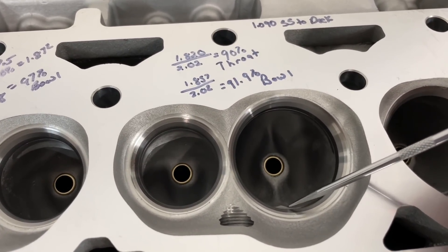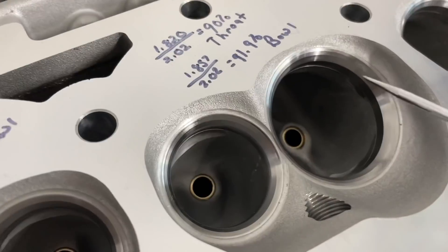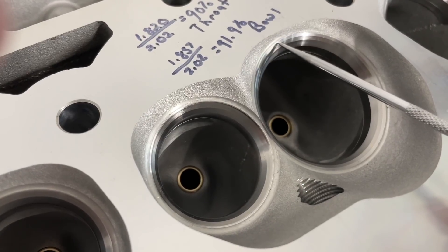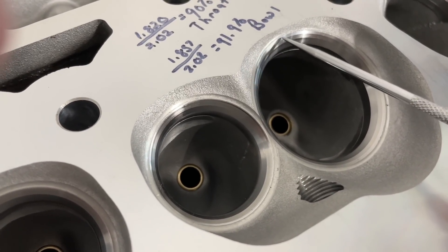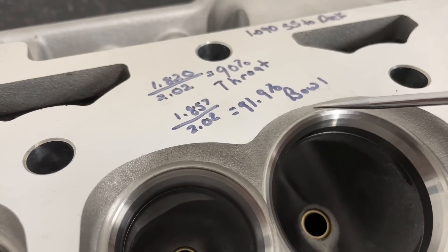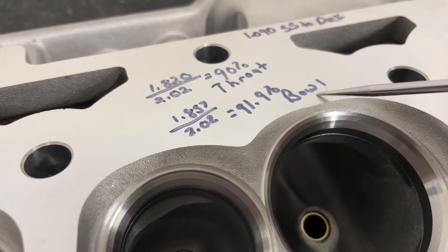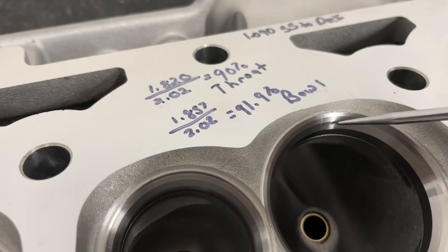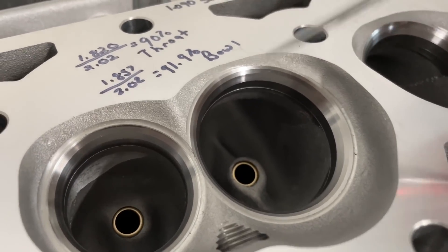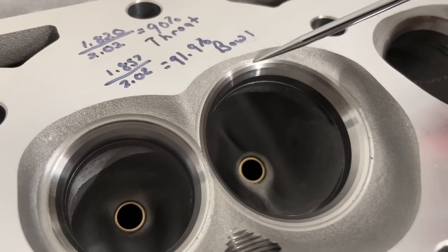So not a whole lot. Exhaust looks like one and then a radius, which is normal for exhaust, and there's probably a small top cut - so maybe: top cut, seat, radius. That's normal. However, a three-angle valve job is not going to flow really great. If you were just to change the valve job you'd probably pick up some flow. All my valve jobs when I cut them will be five angles, and after porting there might only be three because I blend them together - which I'll explain in the porting video. Five is better and it helps with flow. There's a lot of aluminum on this side, and when I surface the head you try not to hit the seat because the cutter will hit aluminum, hit steel, and drag, leaving a mark. These are 64cc chambers.